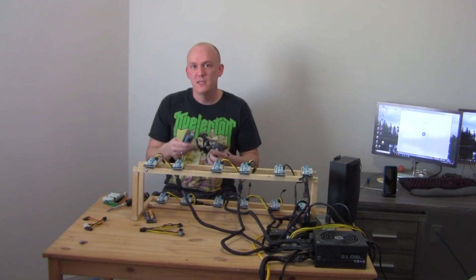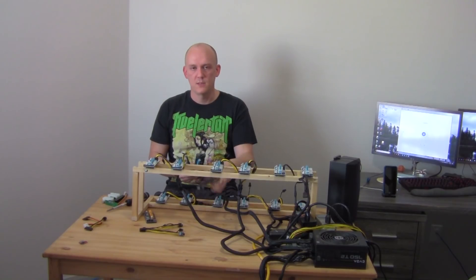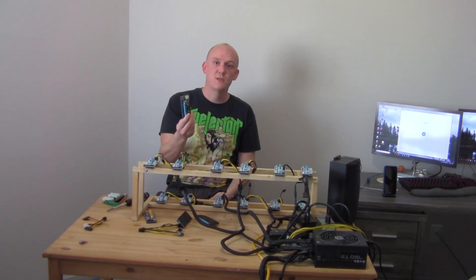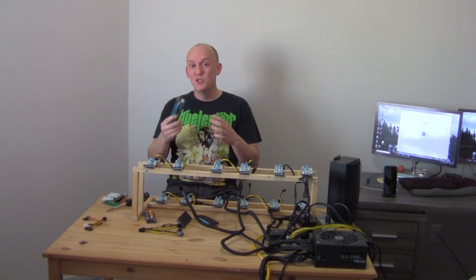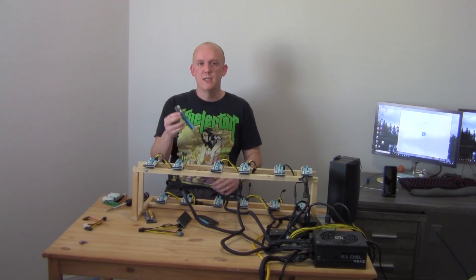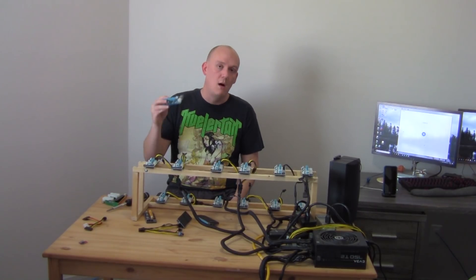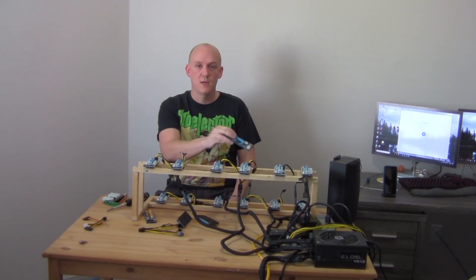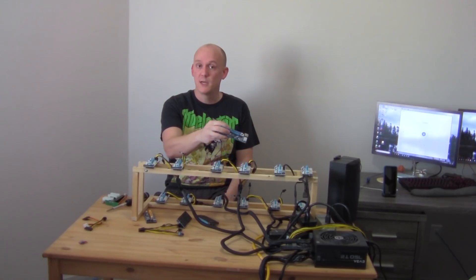To summarize: PCI Express riser, Molex riser, SATA riser — one cable, one riser for Molex and SATA. Two or three risers on one cable for PCI Express. PCI Express is going to be your most reliable and most stable, but it's not practical unless you get a super high wattage PSU, which is really expensive — three to four hundred bucks right now. Just follow these simple instructions and your rig is going to work great. All of your risers are connected to your ATX power supply, and as I mentioned, all of your GPUs are going to be on your server power supply. The next video will show how the two power supplies work together.